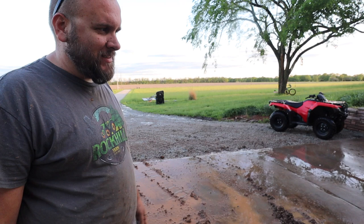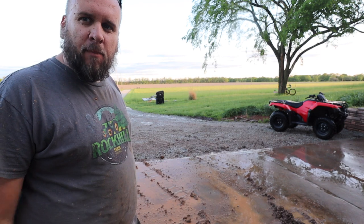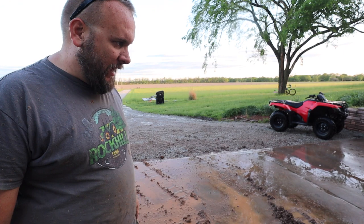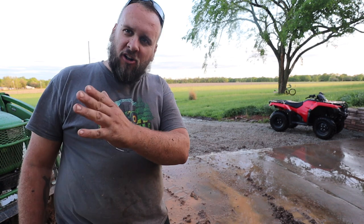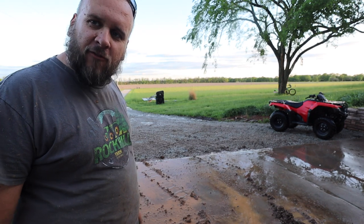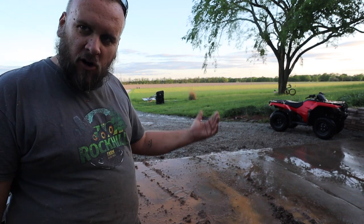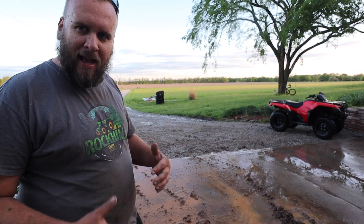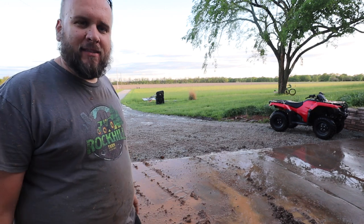My question is: does it make sense to go through that? I spent an hour just getting mud thrown all over me trying to get the mud out of those tracks, and as soon as it's halfway dry, I'm going to spend all day running it in the dirt again. I think you'd just be doing it for the sake of doing it. I do think you need to get the majority of the dirt out of there almost every time you run it, because you don't want it to build up in your tracks and get packed in tight. But completely getting every bit of it out — for someone like me — is kind of a waste of time.